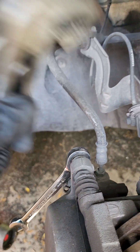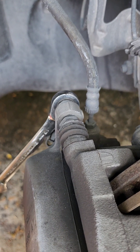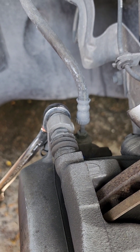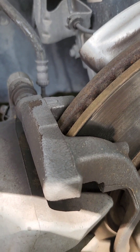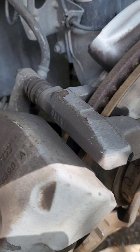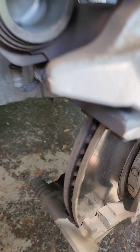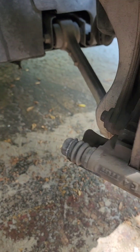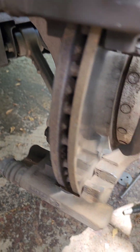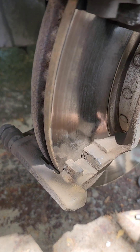I need two hands. As you can see, I removed the brake pads. I didn't take the caliper all the way off — I loosened the top one, took the bottom bolt off, and you can lift it up like that. Remove your brake pads, and you gotta put them back as you remove them. Put some grease before you put the new ones on.